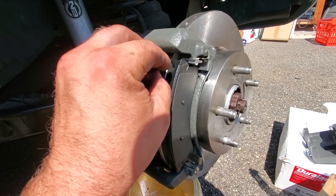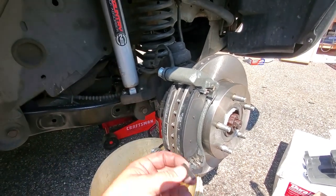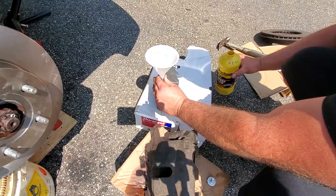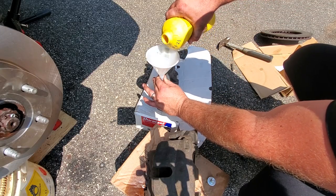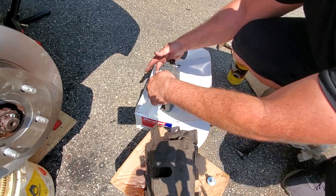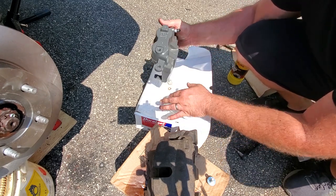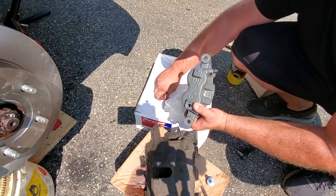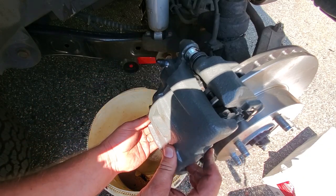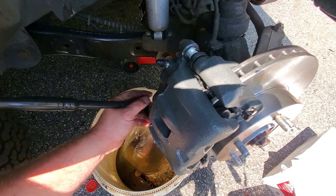Comparing the old and new brake pads — the Akebono ones are more rectangular while the Teves ones are more trapezoidal, like a rhombus with big wings. The pads lock in nicely. You could put the squeal indicator on these — it grinds against the rotor when pads get low — but let's just check maintenance regularly. Now put on the caliper, add a little brake fluid with a small funnel. Wipe it down — brake fluid is corrosive and will destroy paint. Slide on the caliper and slide in the new 17 millimeter bolts top and bottom. Make sure they line up and give them a wiggle before threading so you don't cross thread them. Crank them down with the 17 millimeter.